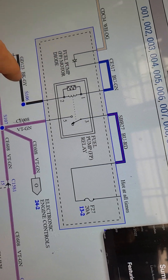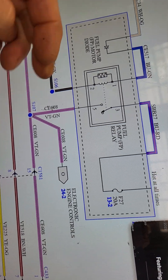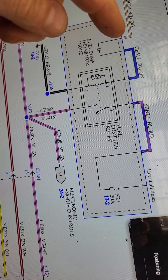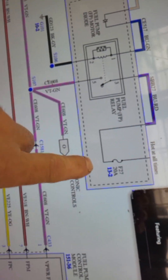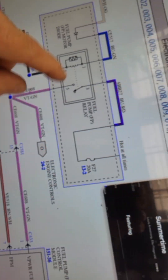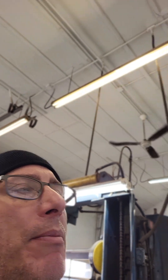What I had to do is cut his 20-amp fuse jumper circuit, where he added his own 20-amp fuse to the opposite side of the fuse panel, cut his wiring, and take the blue wire from 12-volt constant. I moved that over to a 12-volt switched circuit that wasn't being used. Then the heavy blue wire, which is supposed to be 12-volt constant, I moved that to the constant source he had from his relocation of that fuse. Once I figured out where he was going wrong with his wiring and did some quick tests — boom, we got it.